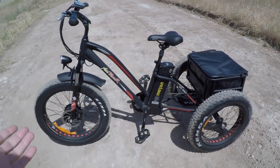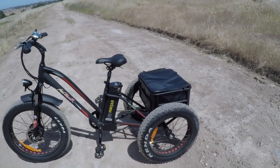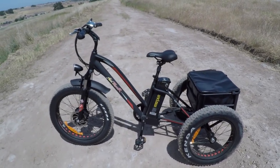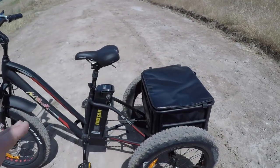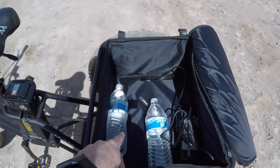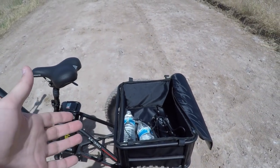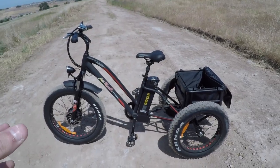The brakes are okay as they are, but not extraordinarily powerful. This bike has a dry weight of about 82 pounds — heavy, but it has a trike frame, front suspension, seat post suspension, and a rear rack. With me at 200 pounds plus 25 pounds of camera gear the braking feels fine. My concern would be loading the full 350-pound cargo capacity — I'd want to keep it at a lower speed with mechanical brakes.